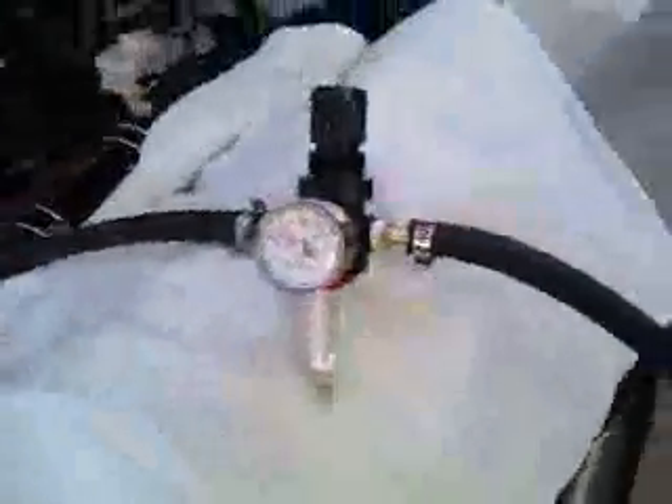What we did — we cranked that thing up to about 70 pounds, put the regulator on it, and we're running right into the manifold right here with just air pressure. We wanted to see if the fuel rail was leaking, if it was going to hold any pressure, so we know what to expect as far as the leak rate goes.